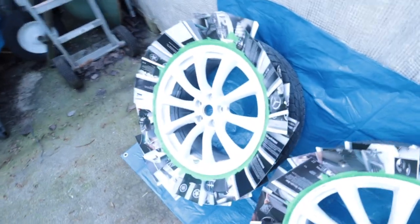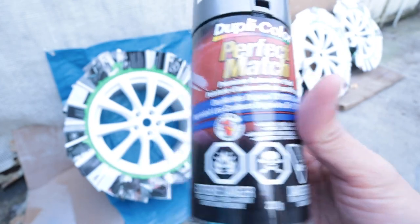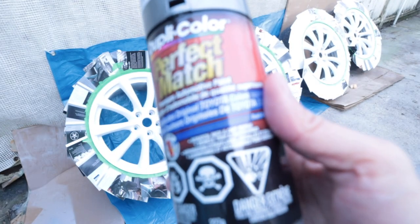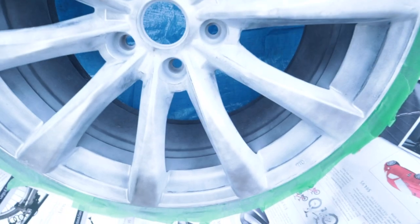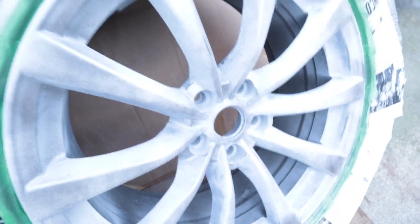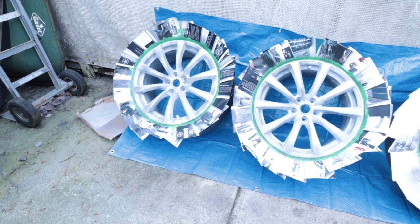Got the wheels all masked off and ready for paint. I'm gonna give them a quick wipe-down and then we can get started. The color I'm going with is Phantom Gray Pearl — it's a Dupli-Color for Toyota. Here's what it looks like after the first coat — just a light coat. Second coat will also be light, and then the third coat I'll lay it on heavier. That's what YouTube says to do, so that's what we're gonna do. I'll let it sit for about 12 minutes between coats.